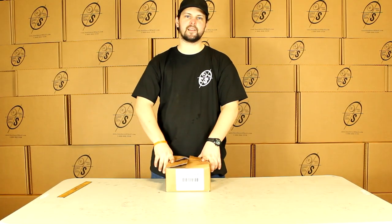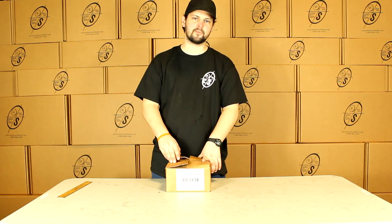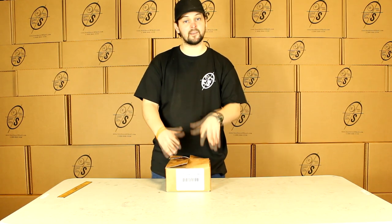What's going on guys? This is Taylor from the Southwest Wheel Warehouse. Today we're going to be looking at the APT-5BX. This is going to be our weld-on hanger kit for a 5,200 pound tandem axle setup. These do require the double eye springs and to be welded on.